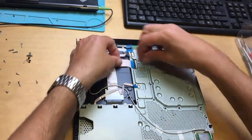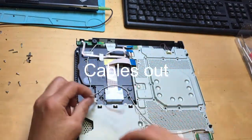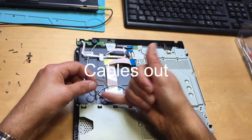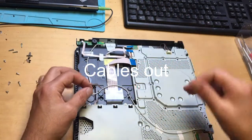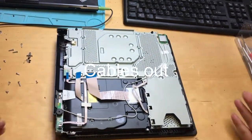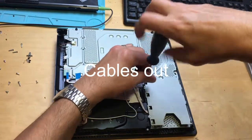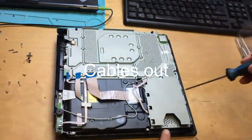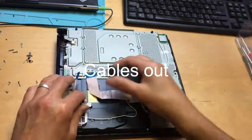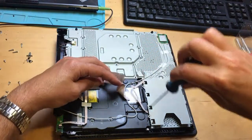You've got to take all these cables out here. Be careful with this cable here — you don't want to be pulling the other end of this cable out, which once we've got this black cover off you'll see what I mean. I'm going to take out these two screws here from the hard drive area — I've already removed the hard drive.